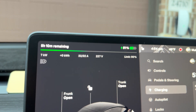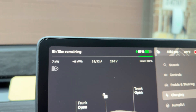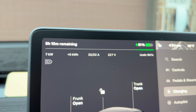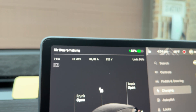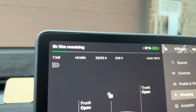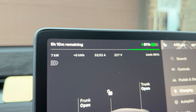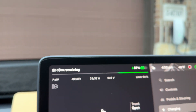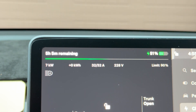Now I'm going to go into the Tesla Model Y to show you what's going on there. Yes, it is success — we have the full 32 amp out of 32 amp, at an economical price. I'll try to get a discount code from the seller and put that in the description too. It's going to take about 5 hours and 10 minutes to charge this — it's at 51% battery and the charge is coming from the Cybertruck. This tells me it is a pretty good charger.